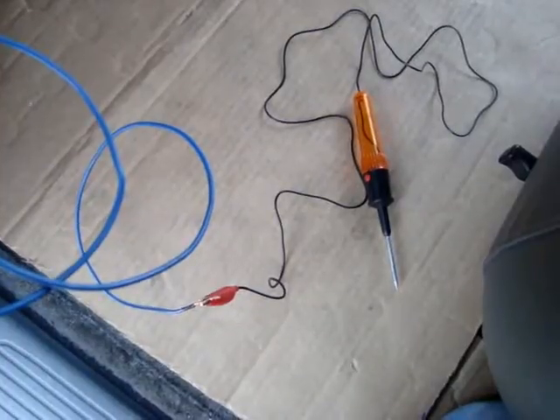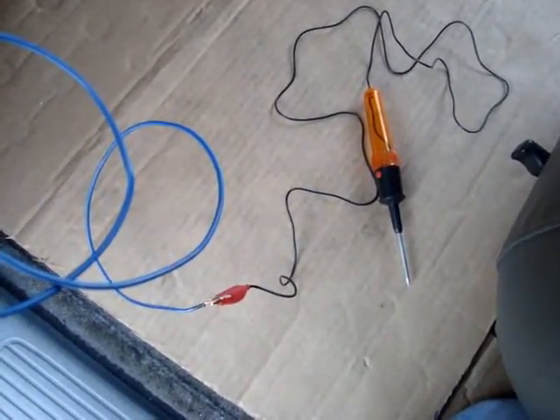It's a power seat, so I got some juice from here. The source is underneath the seat. You could go directly to the battery on the positive side, but I'd like to do it this way. I'm gonna show you how to test the current — the wire of the tester is too short so I have to make it longer and connect it to the alligator clip.